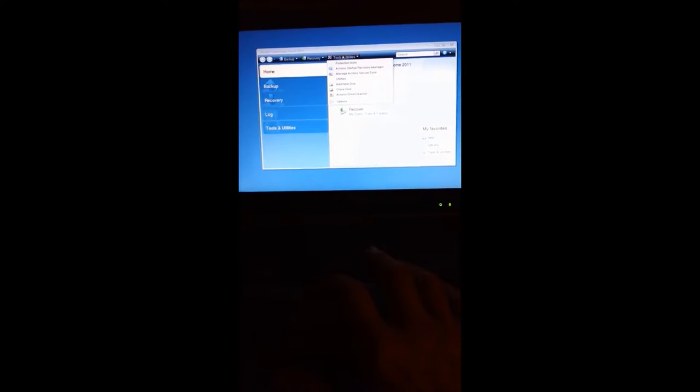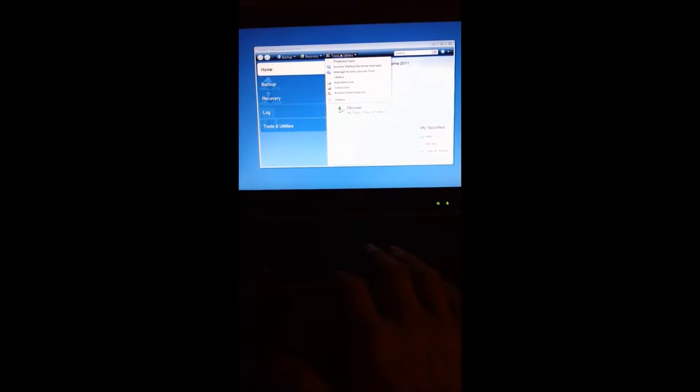So there is an Acronis premium version available that will actually load the drivers. If you're cloning to another computer, it will load the drivers so you don't have any conflicts and you wouldn't have a blue screen issue theoretically. So here we just go clone disk.